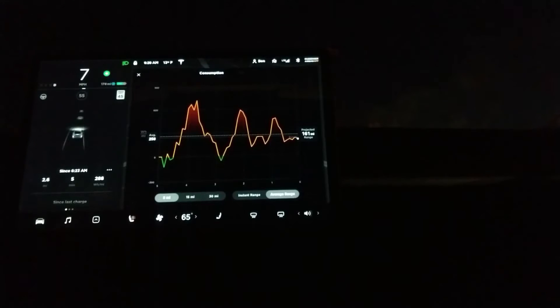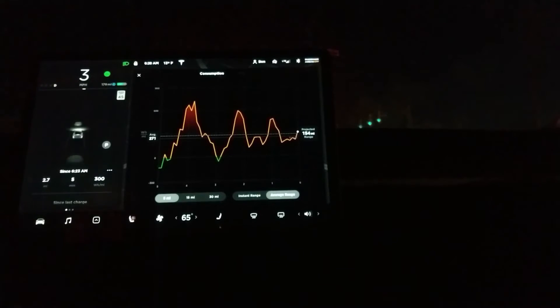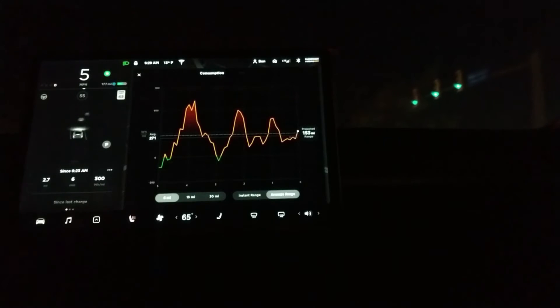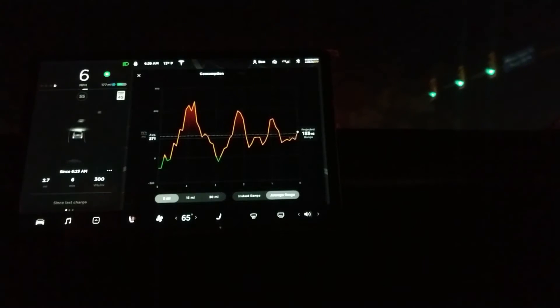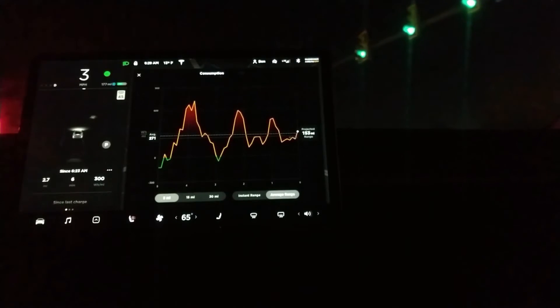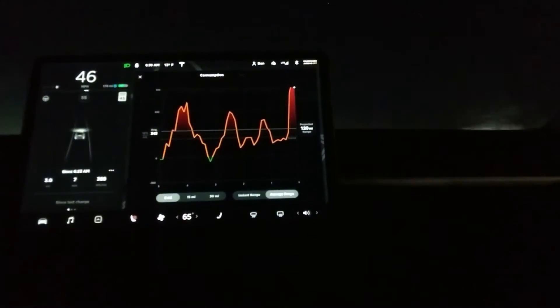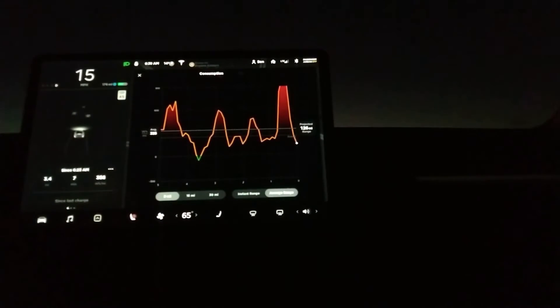More than the seat warmer. The seat warmer works great for five to ten miles, but does less so with longer distances. Interestingly enough, it's showing that I should be able to get a little bit of energy through the regenerative braking. I think where that's actually showing up is it's converting the regenerative braking into heat for the car, which is kind of neat. So the regenerative braking will work a little bit better if you have the heater turned on. You can see though that our power usage has just absolutely spiked.